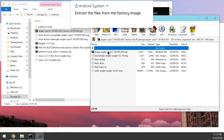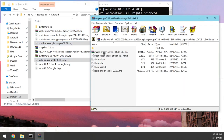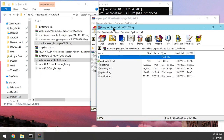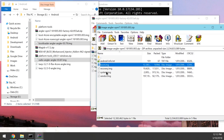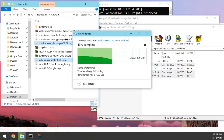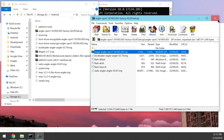Leave the command prompt open and go back one folder to where everything else is. Open the factory image zip, open the folder inside, and extract the bootloader and radio images outside. Then open the image zip file inside — give it a second to extract — and once done, extract the boot, system, and vendor images outside as well. If you're using one of the patched boot images, you don't need to extract the boot image from the factory image since we won't be using it.